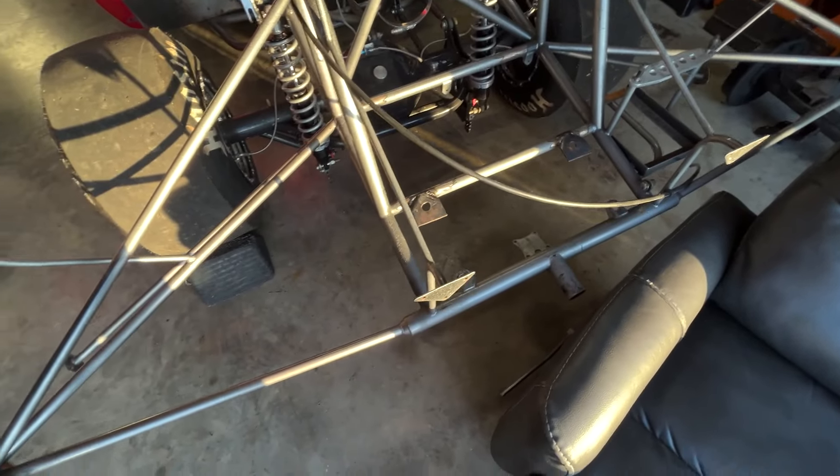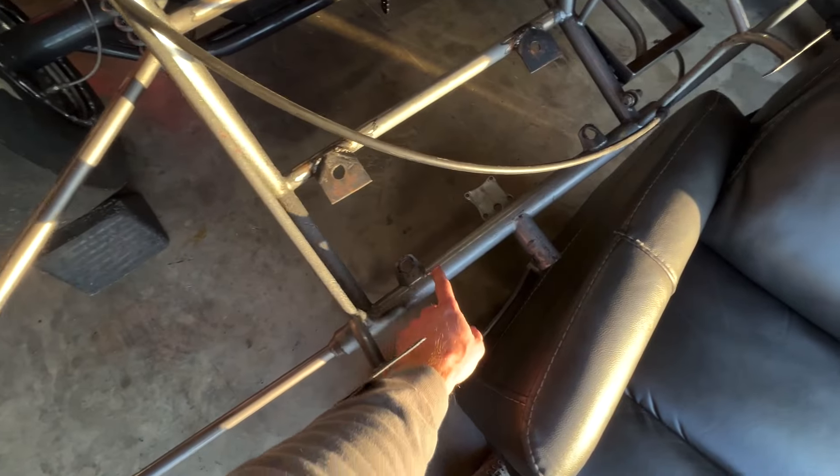41 pounds — that is 0.8 lighter than the other bedside. And that one's got a freaking gas door in it. So I need to clean it up — I'm going to take the grinder to some of these edges. I'm also going to chop this off, probably do an L in it because I like that little support. I also want to chop this bar off. Here's the reason why — I have to cut out around the tailgate and around all this stuff. I want to be able to put a damn tailgate on it and not have to cut it up so bad. I want to be able to have a fully functional tailgate — I want to plop it, have a hanger, so I can sit down on the tailgate. Because it's a freaking pickup truck — that's how they were made.